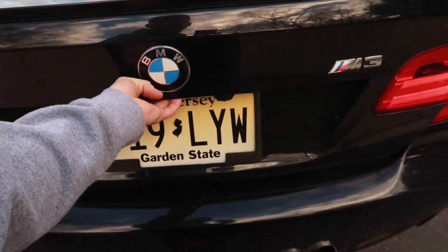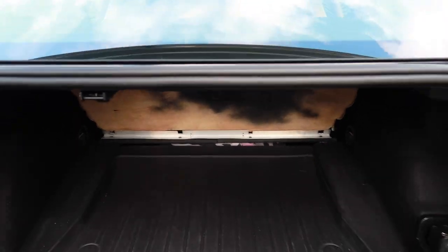But I realized why my car has so much drone. I have a rear seat delete, and since I deleted my rear seats, that is a lot of sound deadening from the factory that I got rid of. I was talking to a friend at work about it — rear seats are like 4 to 5 to even 6 inches thick just the backs, and the bottoms are about the same thickness. That's a lot of foam that I deleted, and that foam acts as sound deadening. I'm pretty sure I have a lot of drone because I have nothing blocking off the trunk. If you've ever driven around with your rear seats folded down, you notice your exhaust is a little bit louder from the inside, and you hear a lot more road noise.